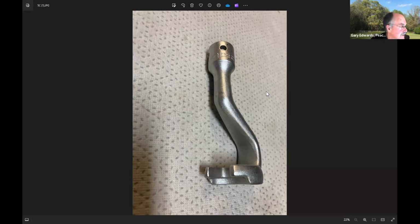And I see another question there about coolant. Yeah, the pink stuff, Porsche uses that pink one, G40 as well. The G05 is the one for the older cars. You have to be careful about fluids in Mercedes, as you probably know. Automatic transmission fluids change, oils change, and coolant changes. G05 is usually safe for the older cars like the 124s, the 107s, and such. And then you get into the really new cars and you get into that unusual pink stuff, but I don't have any newer cars.